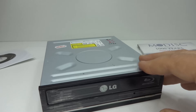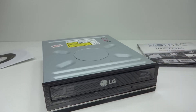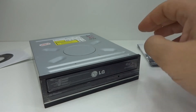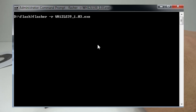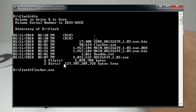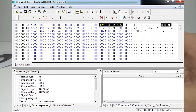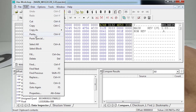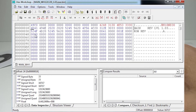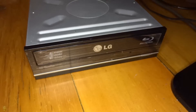I don't normally have this drive on my computer because my case doesn't have a space for it, and I don't use optical media very often, so I only dig it out when I need it. Some people have worked out how to do drive firmware cross-flashing, and there are some tools available. I got the firmware from the M-Disc compatible drive and extracted it. You have to fix the checksum so that this drive will accept the patched firmware. I did back up the firmware from this drive — it's recommended when doing this sort of risky maneuver — and then simply uploaded the patched firmware.